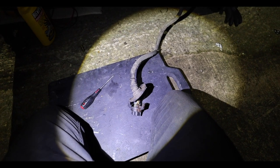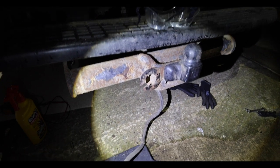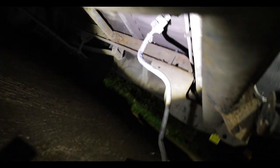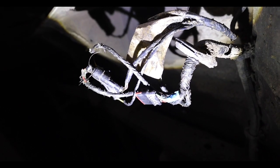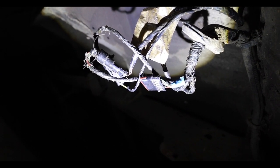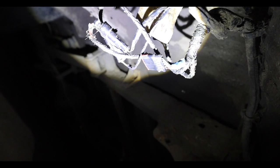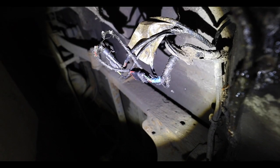I'm kind of glad we took this off just to get that water out of there. So this is as far as I've got tonight. I followed the cable back to the connection and disconnected it — made no difference at all. Then I followed that cable up inside the van and I've managed to get all of this out, but I can't find which connector it is. It's all part of the same wiring loom and it goes to the front. When I disconnected those connectors, the main lights stopped working.